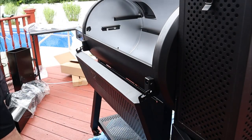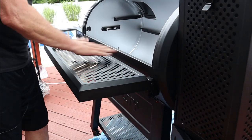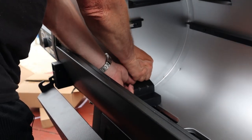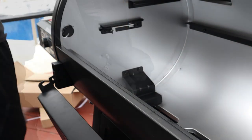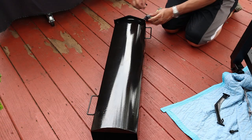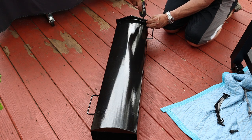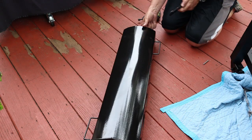I do like the little holes in the shelf, the control panel, and the shelf on the bottom. Next, go inside the pit — there's a little bracket that's going to hold your heat assembly, two screws. From there, get your heat assembly ready — it has two brackets that sit on top, two screws in, easy peasy. That thing is huge.